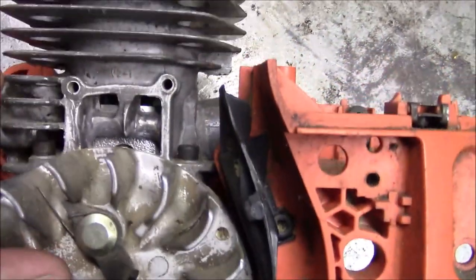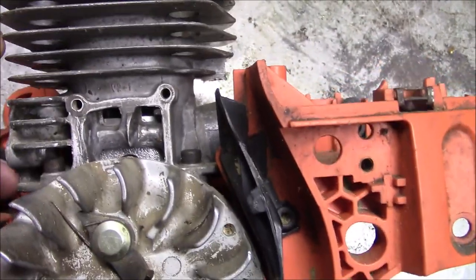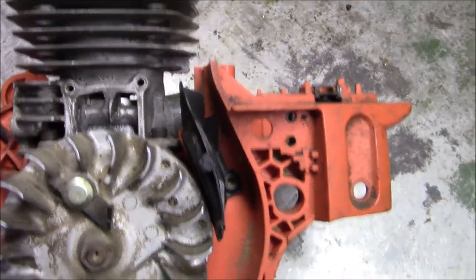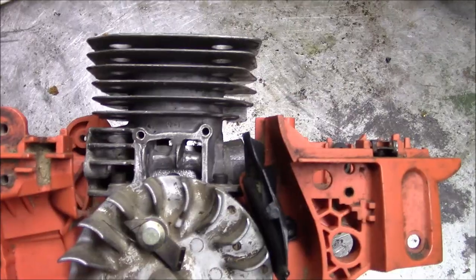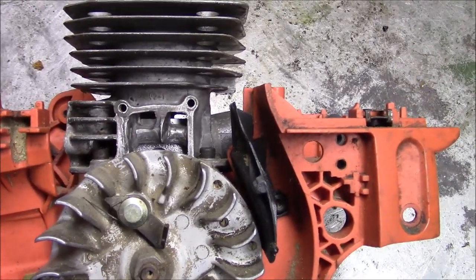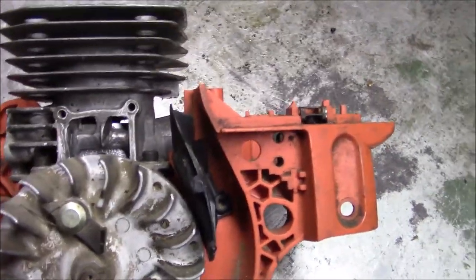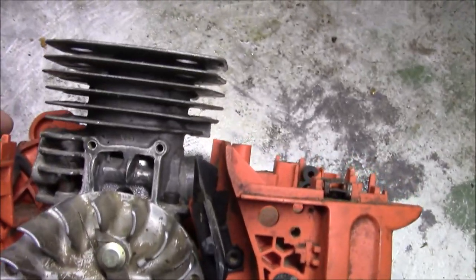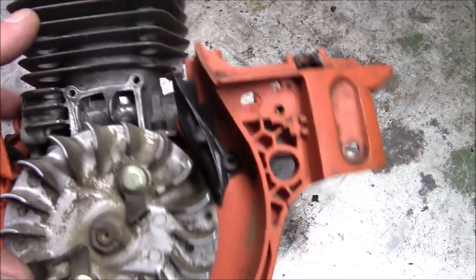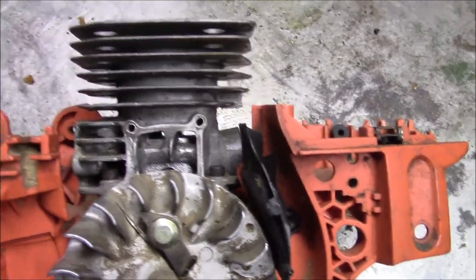But you're going to tell me that's optimal there, by cutting the squish band and dropping the cylinder? Come on. All these builds are compromises, you know what I'm saying? So a lot of times the build which is most likely to happen by a person is the one that they actually can accomplish and replicate with the tools and the machining and the skills that they have. It's a derivative. If you're a hammer, everything looks like a nail. If you've got a machine shop set up to be able to do these cylinders and do single point, that's what you're going to sell. If you can do pop-up pistons and get roughly the same performance, that's what you're going to sell.